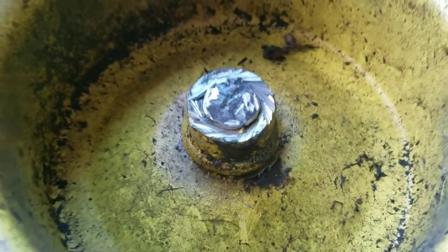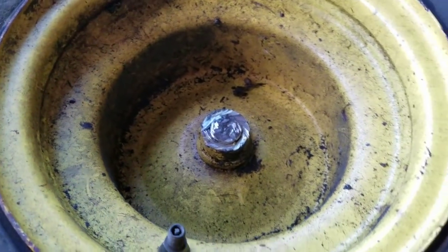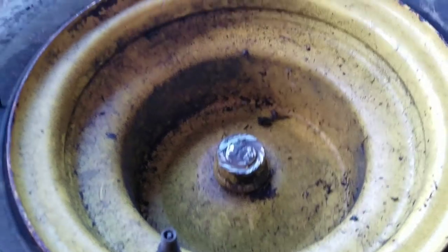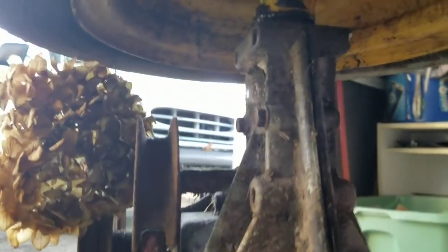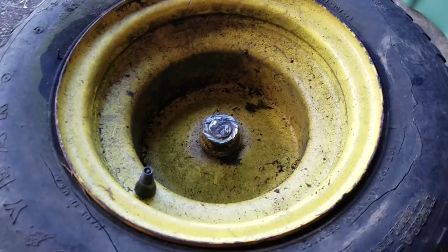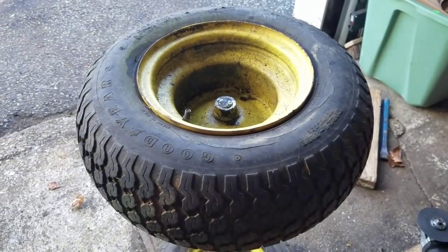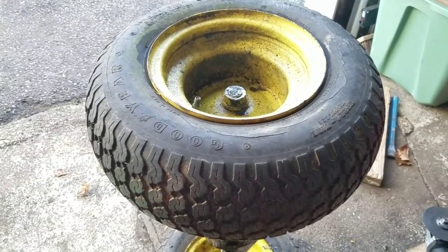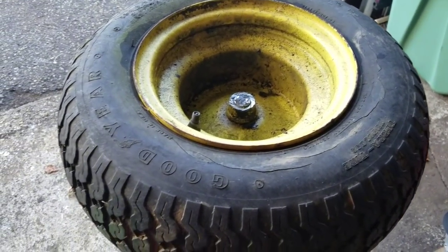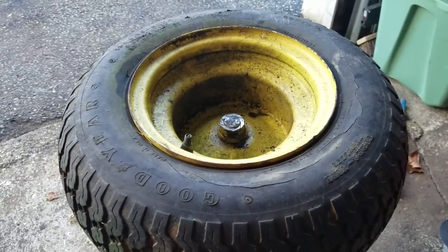I've pretty much tried everything except for a flywheel puller, which I do have, but this one doesn't have holes to put the studs through. Theoretically I could drill two holes and stick the stud through and put nuts in the bottom, but I don't want to ruin the structural integrity of the wheel — which completely defeats the purpose. I'm going to bang it some more. The liquid wrench did get it to move about three quarters of an inch off — it's just that last bit I can't get off. If I push it back down again and use some more liquid wrench, then try to bang it all over again, maybe that'll work — I'm going to try that.